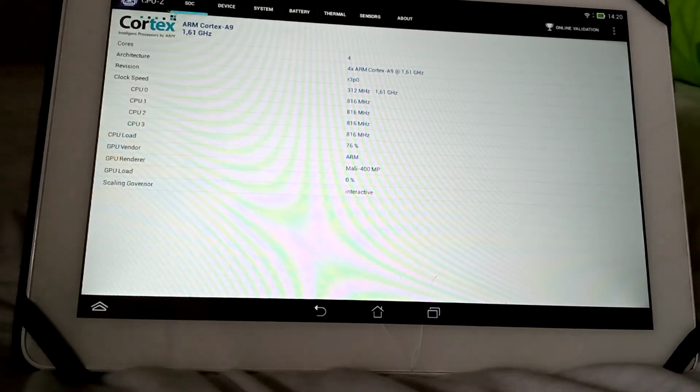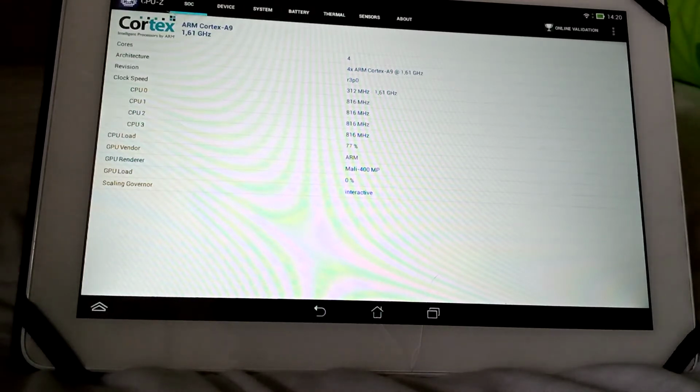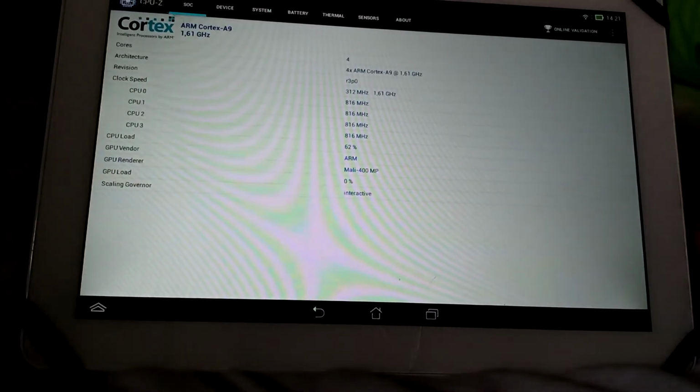You probably know when you take apart an LCD display, you get one of those frosted looking filters. The thicker or more frosted they are, the less bright your colors are gonna be. And you're probably thinking, why not replace it or remove it? Well, you can break the display while removing it, and you probably already do because it's stuck on the display, and your whole LCD is gonna break from that. And by removing it, you can literally just break the LCD, and the only thing you will see is a super bright, just white screen that maybe even can hurt your eyes. So I don't recommend doing that.